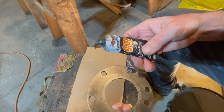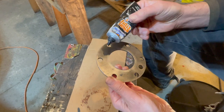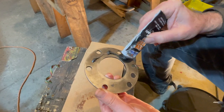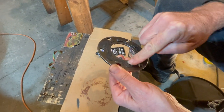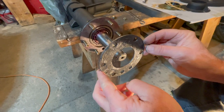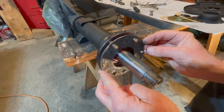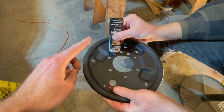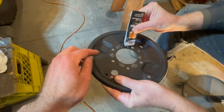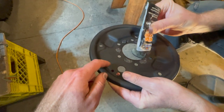Now loosen all 6 nuts. Make sure to apply Permatex — the right stuff — we have 90 minutes on it — to the bearing retainer. Give it a nice coating all the way around, just on one side: the side that goes against the brake backing plate. With an even coat of the right stuff gasket maker applied to the bearing retainer, just install it onto the bolts, sliding it on. We are also going to apply a small bead of the right stuff Permatex to the back of the brake backing plate, but don't go too far and get gasket maker all over the back of your plate.